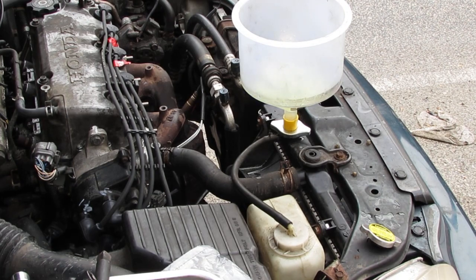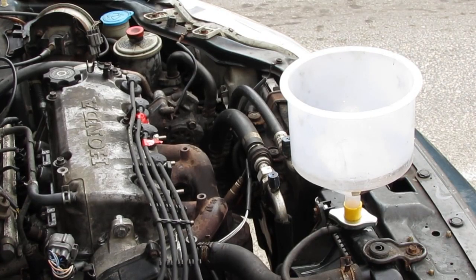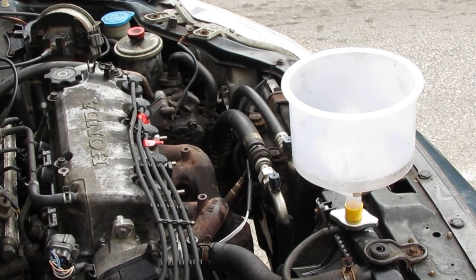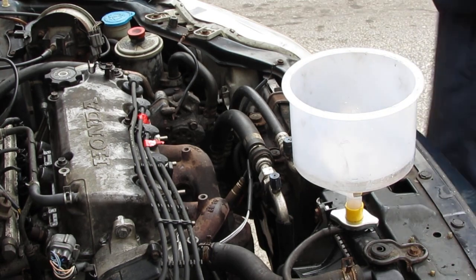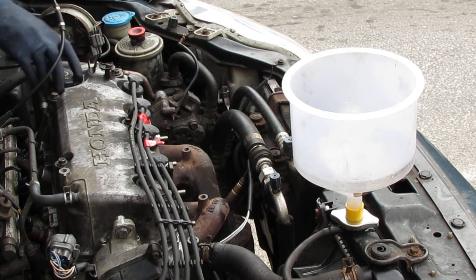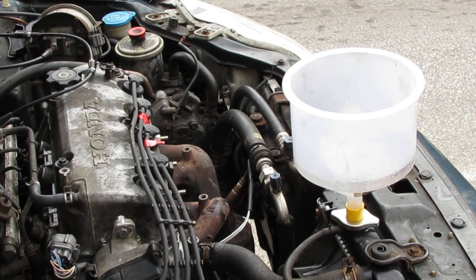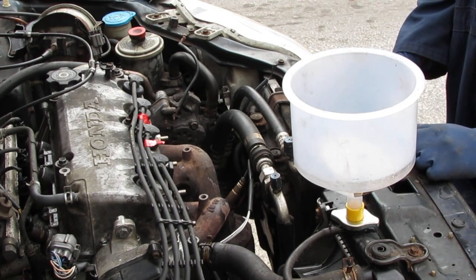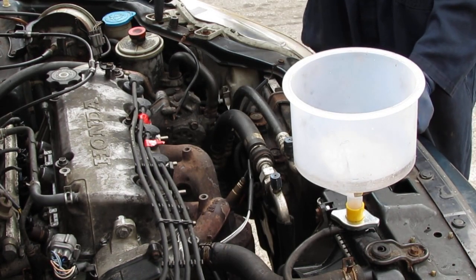So what I'm going to do, I'm going to turn on the engine, put the heat all the way max so that we can get the thermostat to be open, and then we can get the coolant flowing again. Just see what we end up with, okay? That sounds really good. Alright, so that engine is like a brand new engine. Alright, that's burn off from the coolant. Belt's smooth. Let's continue to fill that up.